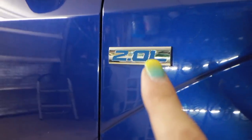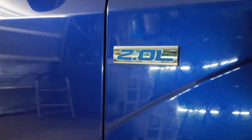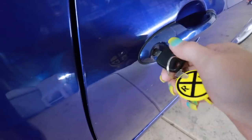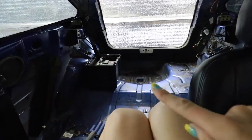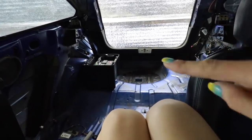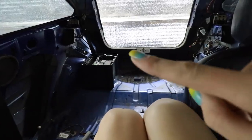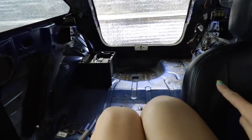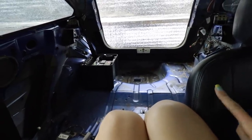Just realized I only have one 2.0 liter badge on the passenger side — it's missing over here on the driver's side. Because race car — I have to keep saying it to myself. I want to make this car pretty and perfect and I can't. It's a race car and a low budget race car at that. So my thought process is I'm going to relocate this battery as far rearward as possible, and also offset it a little bit to the passenger side to make up for the fact that my weight is going to be over here on the driver's side and I don't have a co-driver.